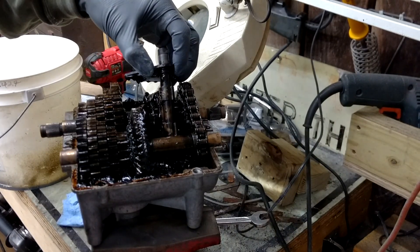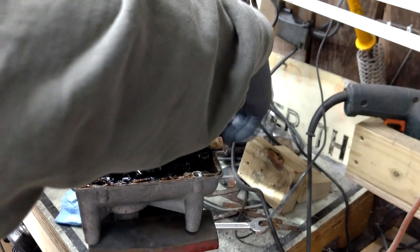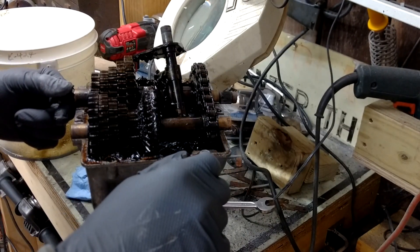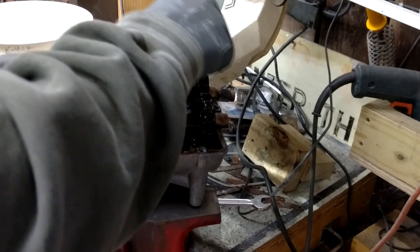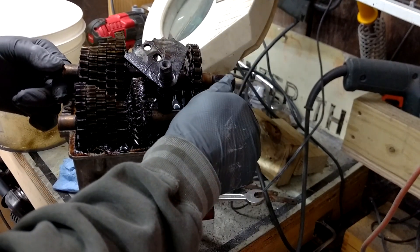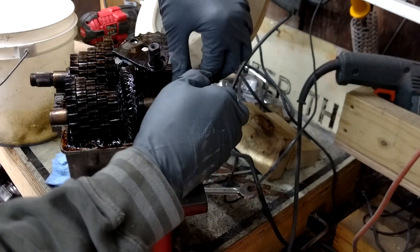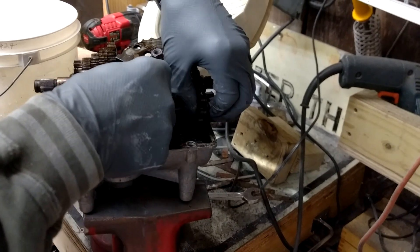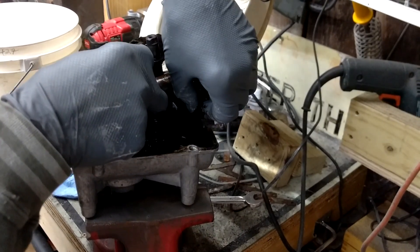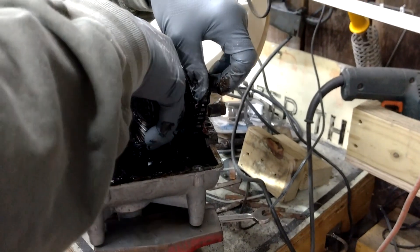This is my shift pawl. I have to lift this front gear set up enough to get it to come out all the way. Maybe I need to just lift the whole front gear set up and out, and that's the second one as well, because I need to be able to get the chain off. And rather than taking the chain apart, I'll just do this. The purpose for the chain, as I recall — it's been a while since I had one of these apart — is for the reverse gear. If you're using this for a racing transmission, they eliminate the reverse.